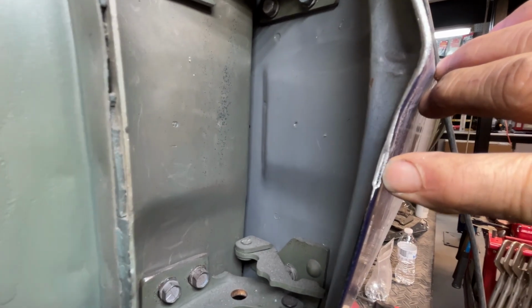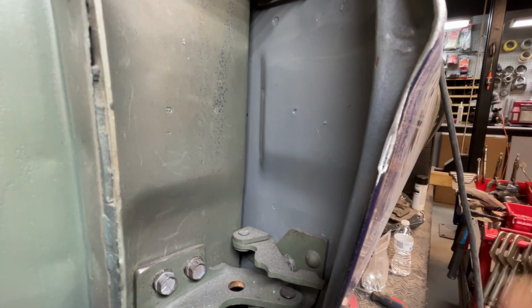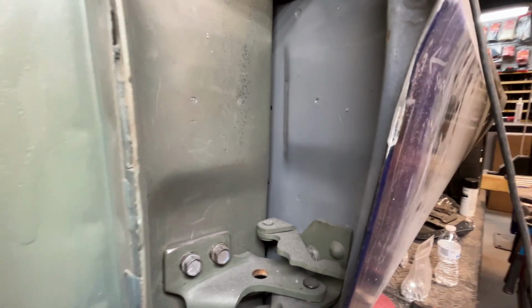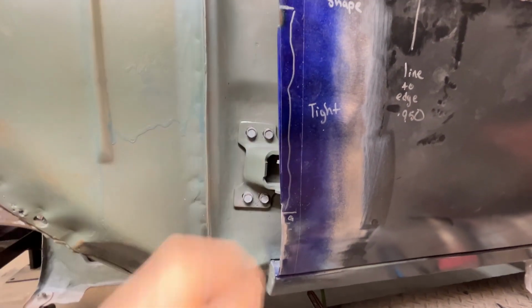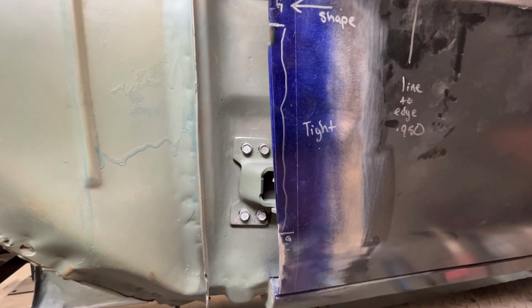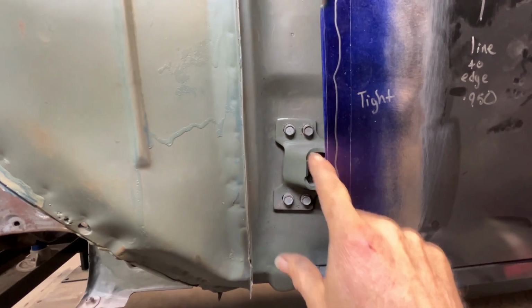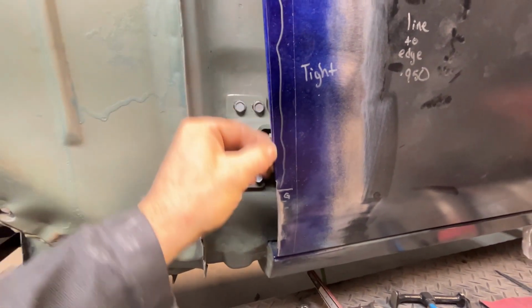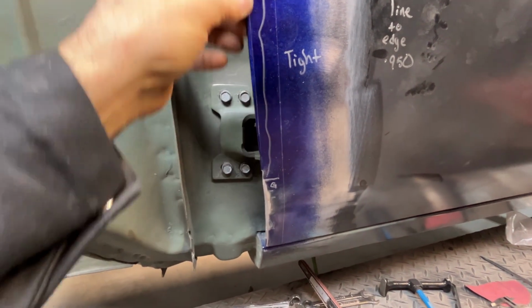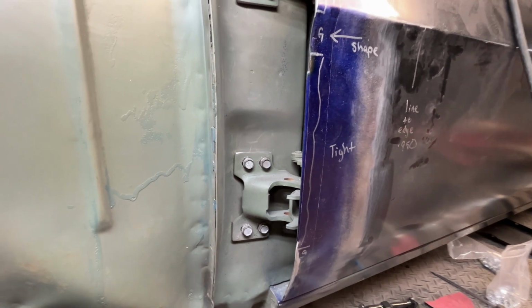If you look real close, that is cut through the lip of the door skin. So that is the reason why I'm going to do this section here in pieces at a time. Basically, I'll end up doing it for the most part the width of my belt sander. And I'll go down through here and get this door skin to where I'm not taking a bunch of this off at once so that it completely opens up. But that's definitely what I was worried about, and wanted to share that.